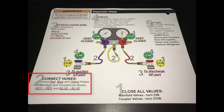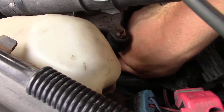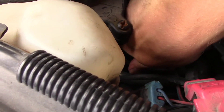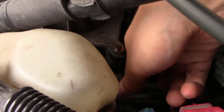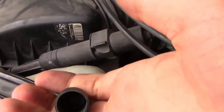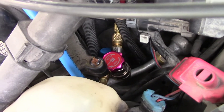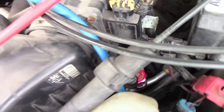Once you have all of the valves closed and the couplers aren't connected yet, step two is to connect the red and blue couplers — we're going to leave the yellow one out for this one. First you have to locate the high and low pressure port sides on your vehicle. On my 97 Chevy Lumina it's over here on the driver's side behind the windshield washer reservoir. Take off your dust caps, go ahead and plug them both up, and make sure they're still both closed.